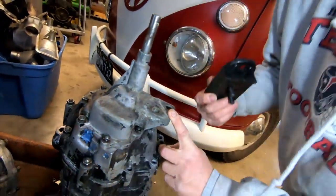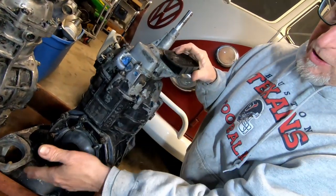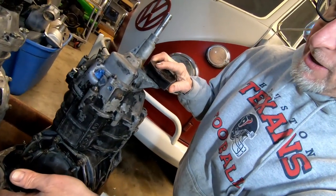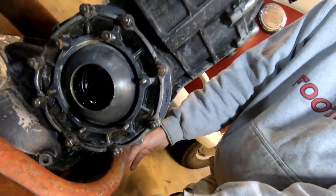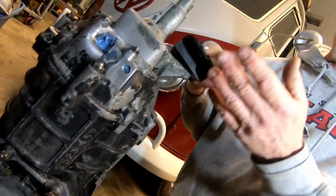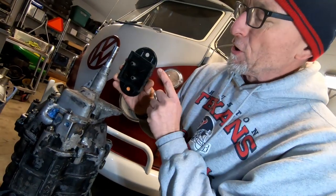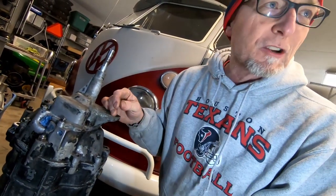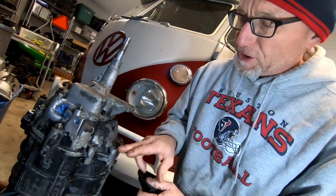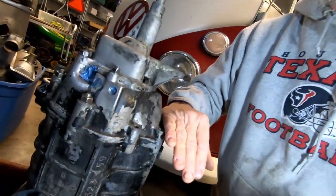So why are these prone to failure? Here's the end of the transaxle, and of course the motor hangs on the end of that. You have nothing besides the cradle at the front that supports the motor and the transmission all the way back, and this is called the nose cone. Two things are gonna happen: you're gonna come loose, or you'll break your nose cone. So the stabilizer is gonna — we're gonna show you how it mounts across here to support the back of the transaxle.